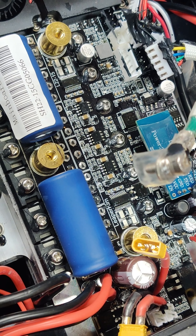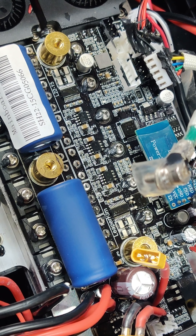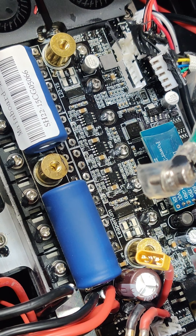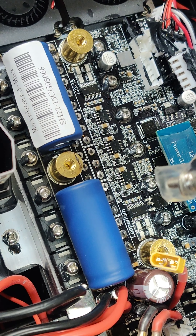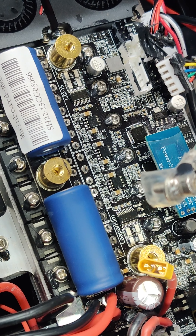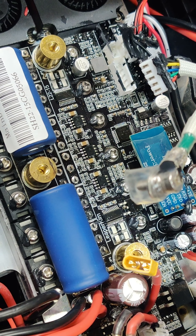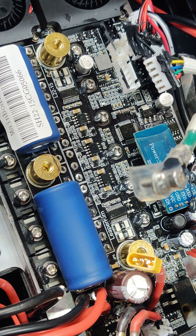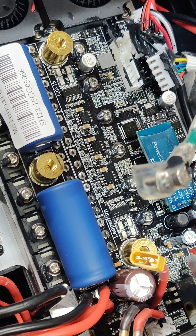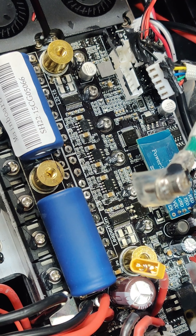Yes, the EX-30 has a bigger motor and yes it's a heavier vehicle, but it's got 36 MOSFETs. I don't know if the number of MOSFETs has anything to do with whether or not I cut out, but I suspect it does and I'm fairly certain there are conditions that apply for a cutout of the kind that I had that could be mitigated if you're aware of them. In my case the cutout was totally unexpected — I'd just gotten on the wheel, I was going downhill, it began to slow down, and the wheel slowly leaned back more and more until it threw me off.